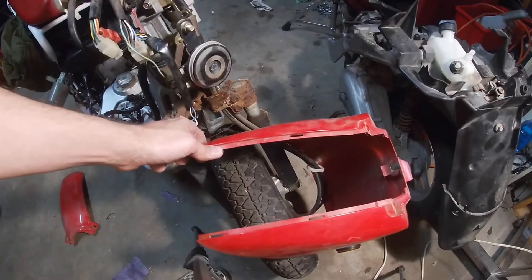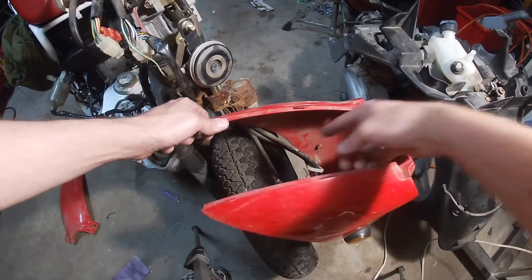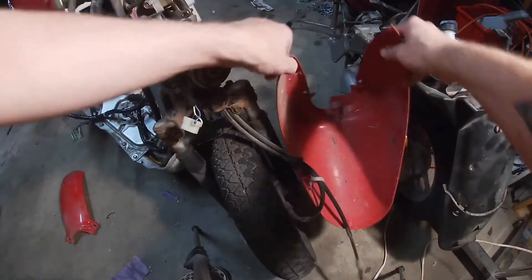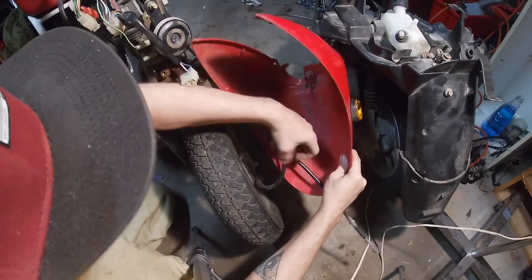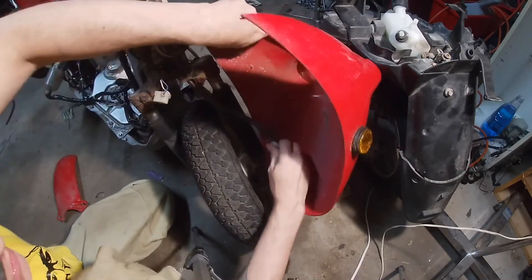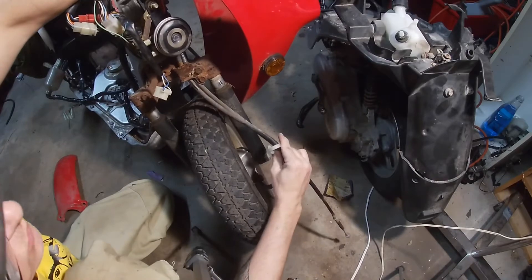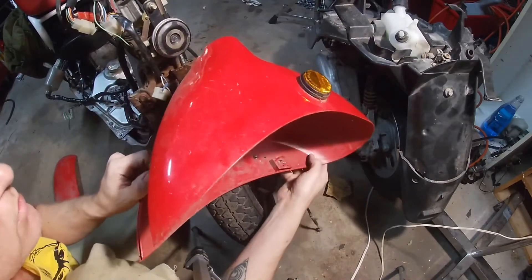You can see there's almost like a zip-tie plastic piece that holds the brake cable and the speedometer, so I can't really pull it off. There's some kind of release over here. It actually just slides forward — it's like an open bracket right there. Turning it definitely helps. And there you go, it just comes out right there.